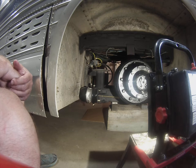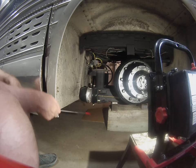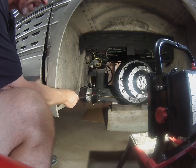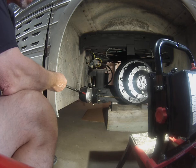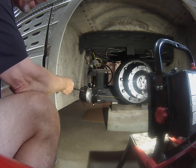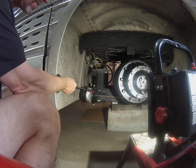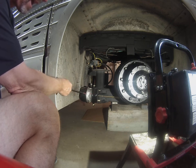When you read up about installing spring brakes on a 4106, the biggest problem that you come across and people talk about is that a spring brake will not fit in the original mounting location. The original brake did live right here where this spring brake is, but this brake is much bigger, and therefore there's not enough room between the bulkhead and the mounting bracket. This can here is called a 30-30, which is probably the most common spring brake. That means the spring brake portion in the back is a size 30 and the service brake portion in the front is also a size 30, so it's a 30-30 spring brake.